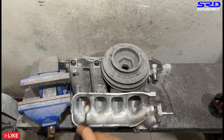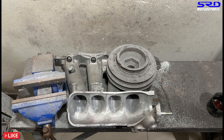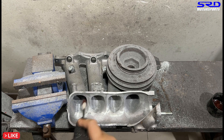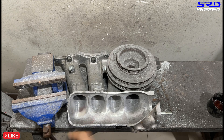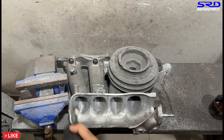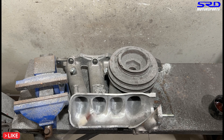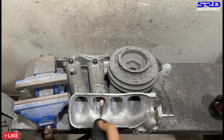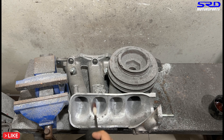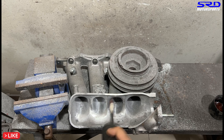Let's go back to the porting bench. We're still with 80 grit, sprayed some more lube. You can see we're trying to expand it all the way from the entry, all the way into two inches into the runner. The flaring is starting to look good. Continue for the rest of the runners — initially you might not notice it was tapering all the way from the entry, but I know these steps lead to a consistently well-tapered entry into the runners.